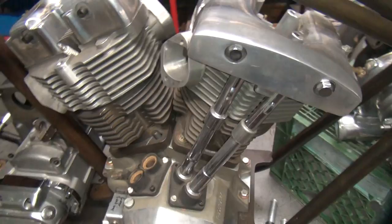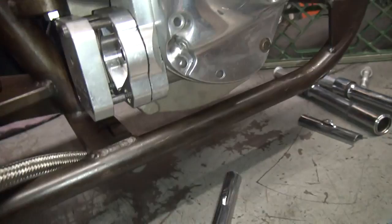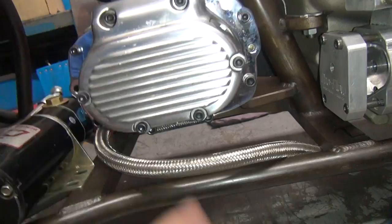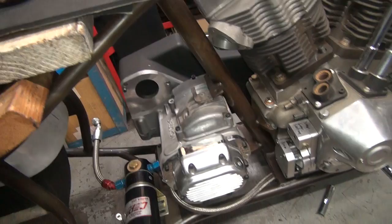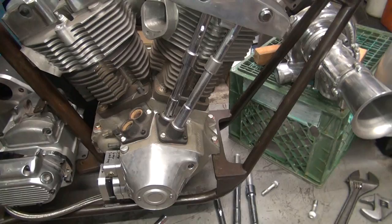I want to use this Zipper's Pro Flow oil pump, which I don't think they even make anymore, but I've got a bunch of them new so that's alright. Look at the size of the gears inside this thing — they're just huge. I'll wind up doing some kind of a good gear set in this thing. I've got some big racing clutches I can put in it too. Going by the head flow, this motor should put out about 190 horsepower on gas.